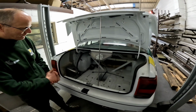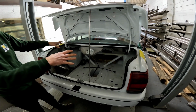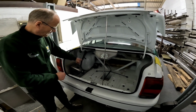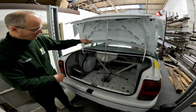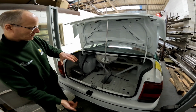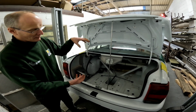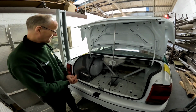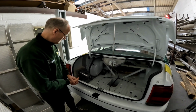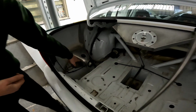We noticed with some race cars that the hot fuel going back in is actually expanding the bladder. When it's full, it's getting under quite a lot of pressure. So we put a fuel cooler on the return. And then the return feeds into the internal swirl pot where the fuel into the pump is picked up. So the cooler fuel is going into the swirl pot, so you're getting cooler fuel picked up, which is slightly more dense.